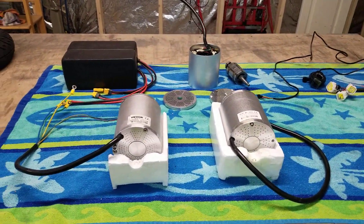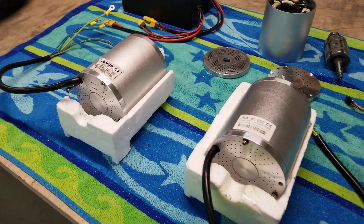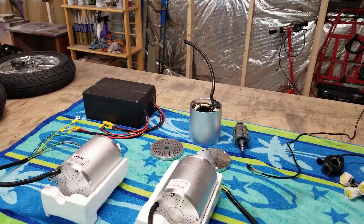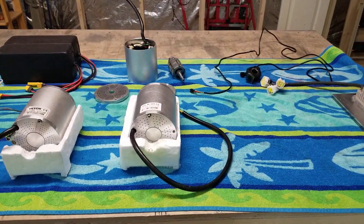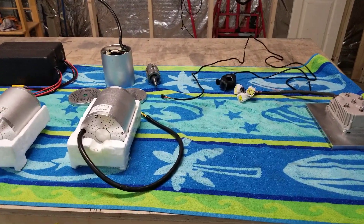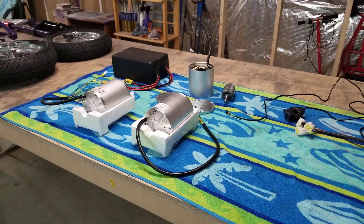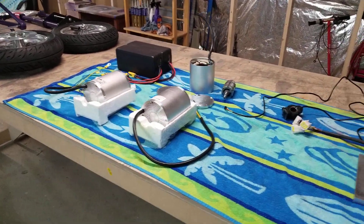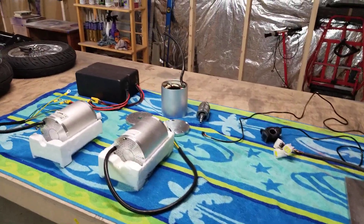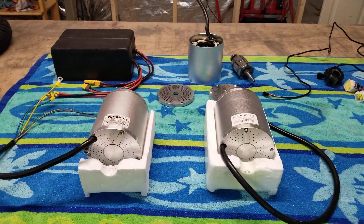So that's the answer to your question, Shark Theater. You don't want a foot, and at your height and weight — wanting speed and torque — a 48-volt is probably your solution. Maybe you can get a bigger 52-volt battery; save money not buying a 72-volt system and put that into better quality battery. That's where your money is, man — your battery. That will also determine what controller you get. Hope that answers your question. Talk to you later.